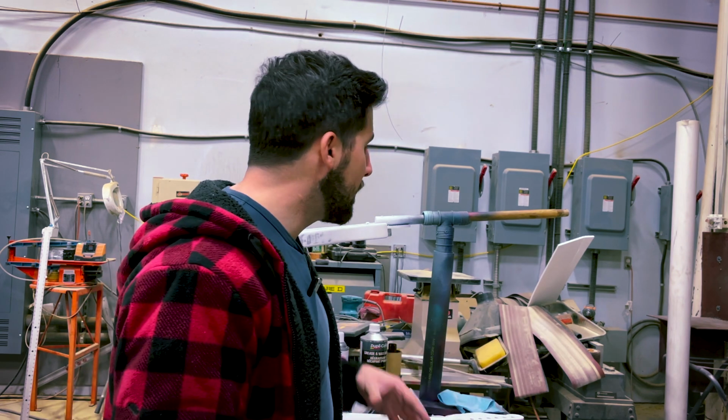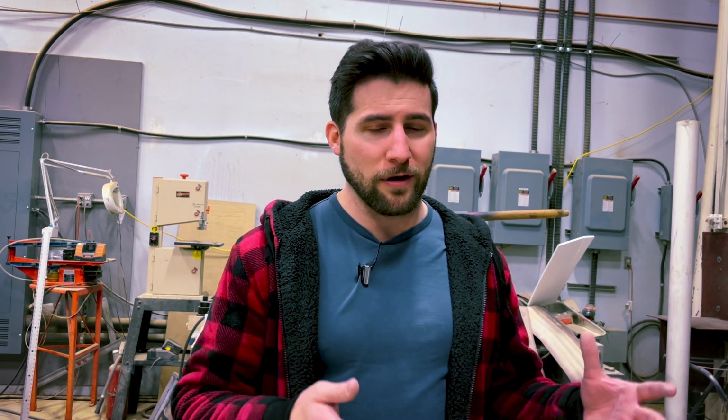All right, guys, that's it for this one. Like I said, just a quick video, just trying to give you a tip. I think this is going to help a lot of you get some of that waviness and some of those issues out of your paint jobs. And I know when people throw paint onto something, they're always nervous about taking it back off. It's not a problem. Putting paint on, sanding back, it's part of the process for a lot of paints. Just make sure that it's fully dry when you go to do it.